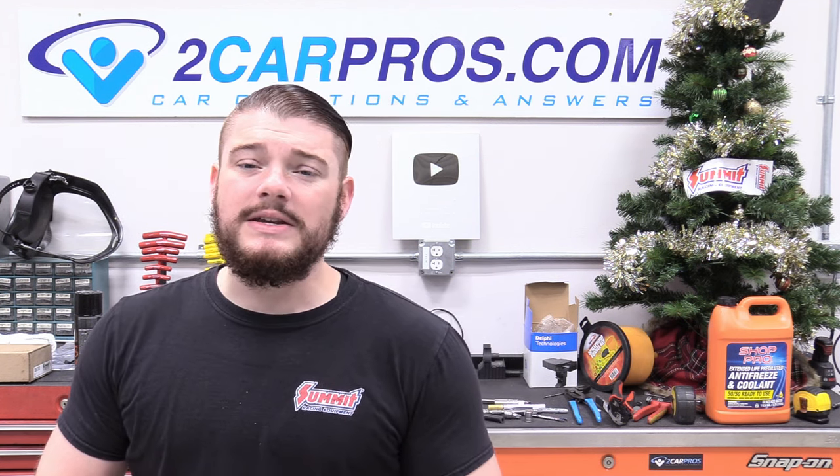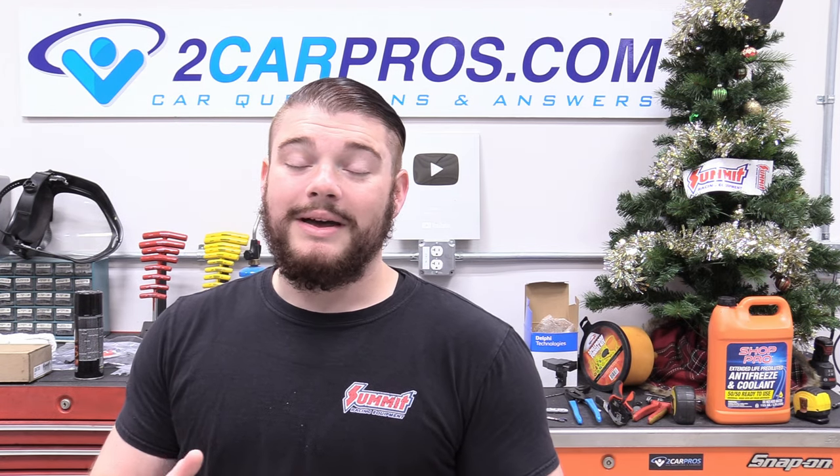We're going to be putting in our fuel pressure regulator. I mounted it up front under the engine bay for two reasons: the red anodization looks amazing, and it's going to be easier to film setting our fuel pressure when it's right underneath the hood instead of somewhere on the frame. If you weren't doing this for YouTube, you could put the regulator closer to the tank to use less fuel line, but for instructional purposes I mounted it underneath the hood.